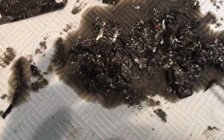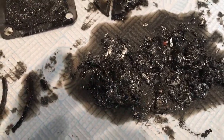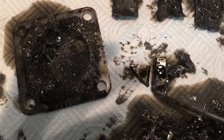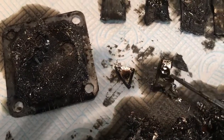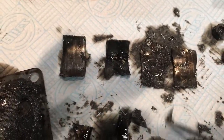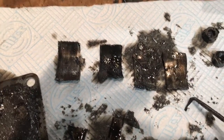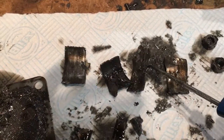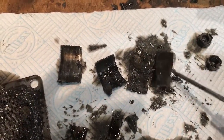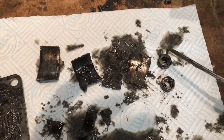When you start looking at some of these bigger pieces, you find that one there looks like a broken piston skirt. And then over in other areas there's more pieces of broken piston here — without a doubt. So this is some of the remains of the left-hand piston. Over here, we're only talking about a pair of big end bearings, so I think these two are certainly part of that. I'm not quite sure about these two pieces — they could be, just flattened out. And then you've got the big end cap nuts there, but no sign of the bolts.